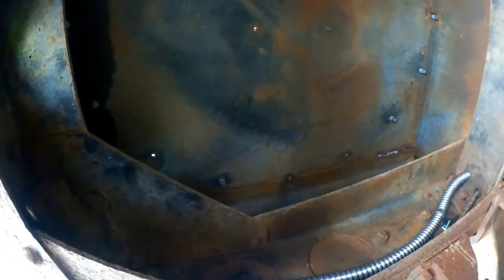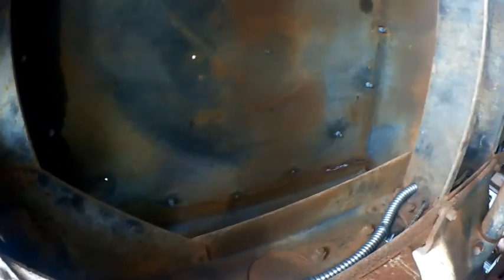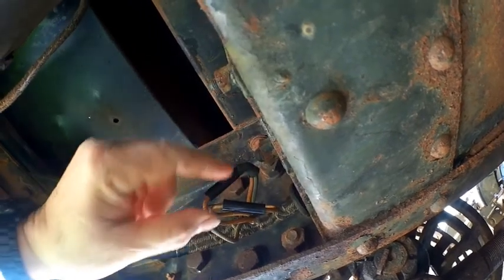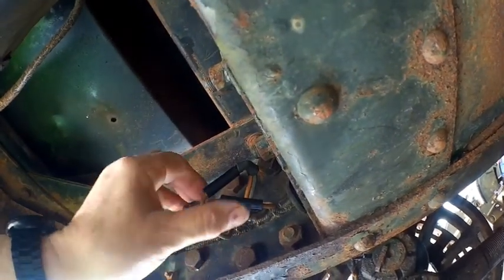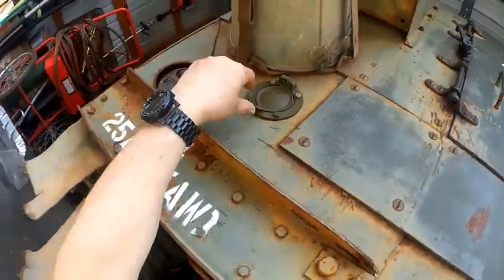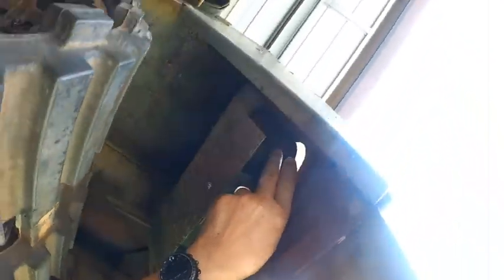Slip ring is what you usually find in a tank. So when the turret runs, power is transmitted from the hull to the turret. That was a feature that was done on his track when it was converted. What you've got back here is your blackout wires. This is a brake and tail light wire, blackout brake and blackout tail light wire, which actually tie into your trailer socket, your resistor here. Then my trailer socket's up above that. That's your trailer socket. You've got three wires that run to your rear tail light here: brake light, tail light, and blackout light.